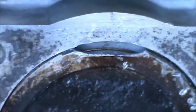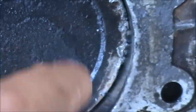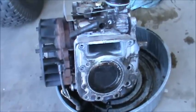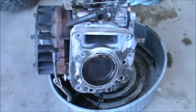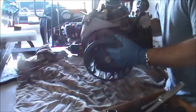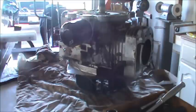If we take a close look you can see the top of the piston broke — just a little piece up top — and that's actually the ring you're seeing underneath there. Once that piece broke off you can see it got kind of mashed. Before I even take the engine apart, I noticed when I flipped it over you can hear inside that there are small broken metal particles. So not only is there damage on top of the piston, internally you can tell something's broken. From the looks of things it's probably just going to be a parts engine.